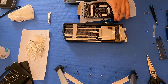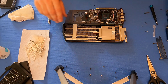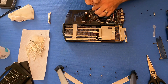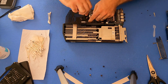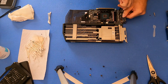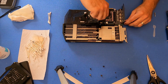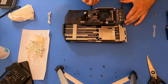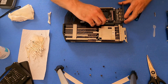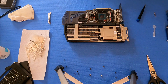Next I'll flip it around. I couldn't get that one connector to disconnect so I had to work on the card this way. There are six screws that connect the card to the back plate, and two of them that hold the IO plate are a coarser thread pitch, so just pay attention to that when you're reassembling it — you don't want to get the screws mixed up. I like to do the star pattern and tighten them all gradually; it's best practice. You could probably get away without doing that with putty, but I still do just because it's what I'm used to.